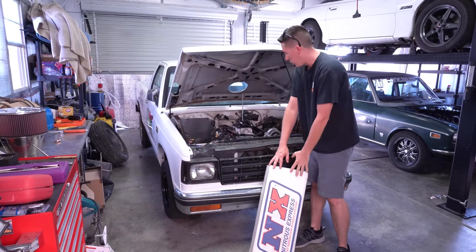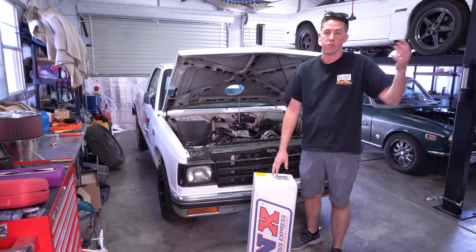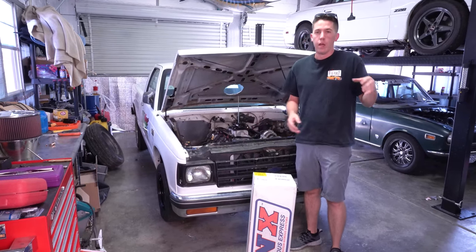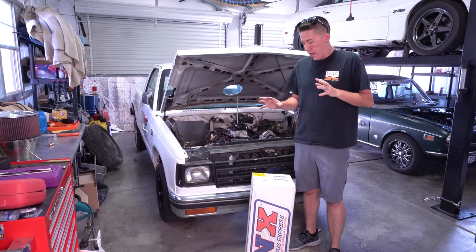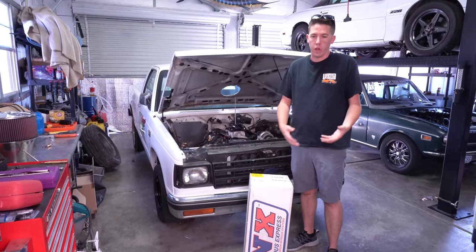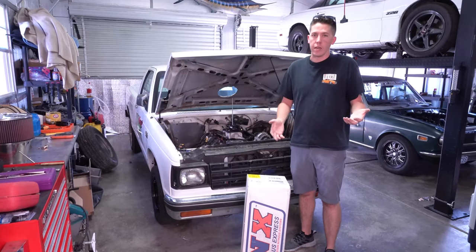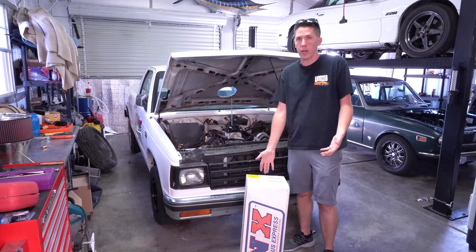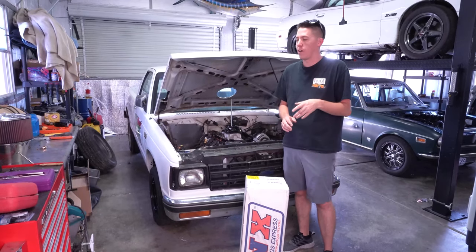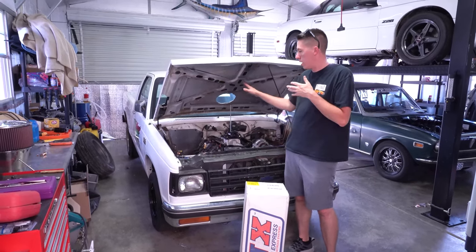So we got nitrous here, it's gonna go on, it's a 4150 plate, but we're definitely gonna get into this more in the next video, or one of the next videos on Burnie. I'll do a whole install. I'm actually gonna do a dry kit and try to play with some of the dry tuning in the Holley. It's something I wanted to play with, that you see all the big 900 inch motors and everything else running four stages of dry nitrous. Well, this is in a sense a similar idea, just a single stage, or there might be a second stage. We'll find out.